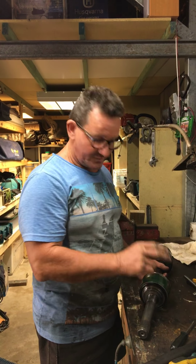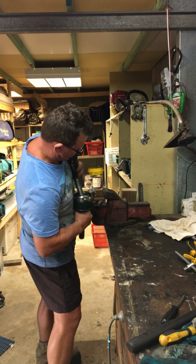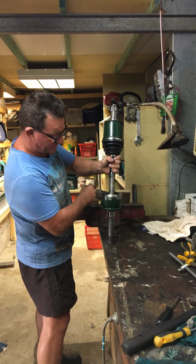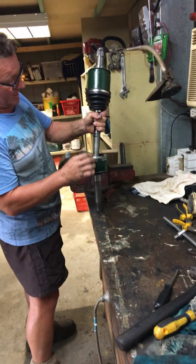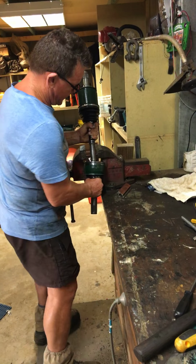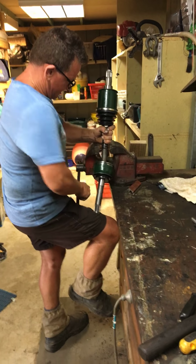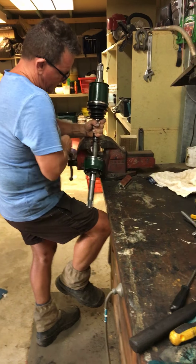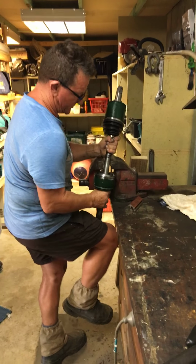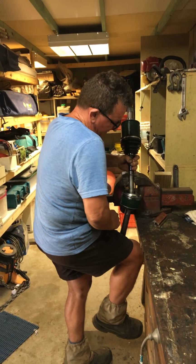So what you want to do to get this outside part of the drive shaft apart is it needs to be solidly mounted. Don't worry about any of these surfaces here because they are not machine surfaces, they are just part of the axle. So a few scratches won't hurt them. What I did, I've actually pulled this one apart and prepped the video up, is you clamp it up in the vise, nice and firm. So, get this clamped up, nice and hard, okay?